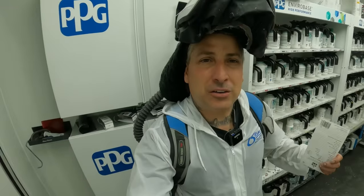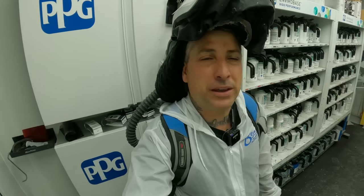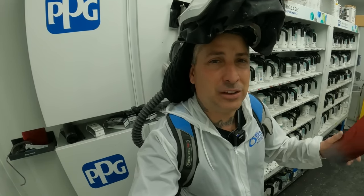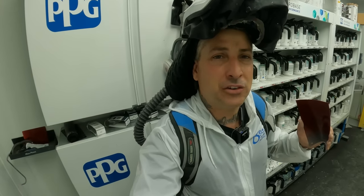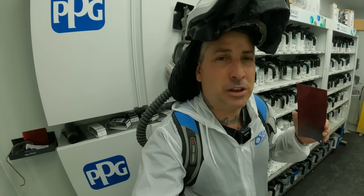All right, so we've got our sealer on, and I used the Fuji spray, and that is a 1.3 head on that gun, and I'm spraying that gun at 24 PSI for the sealer, and it lays down a nice, beautiful flat coat of sealer. You guys seen how nice it looks. So make sure you start off with a nice, smooth foundation. That's how your paint job comes out in the end, because if it's lumpy and bumpy, that's how the outcome is gonna be of your job.